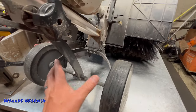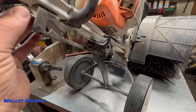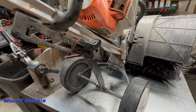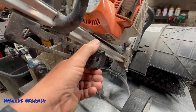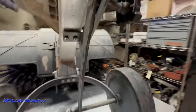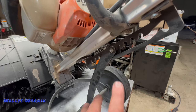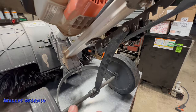The wheel kit comes with the wheels, the entire bracket, and the whole adjuster assembly. It is available as a replacement part. The adjuster wheel — you just want to make sure it's tight. It will loosen up and fall off. The nut on the other side will also loosen up and come off. You want to go over all your hardware, check everything out, and make sure it's snug every once in a while.